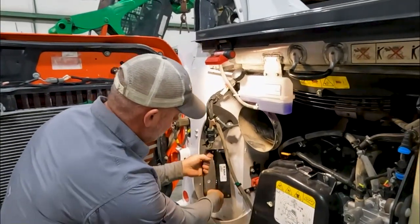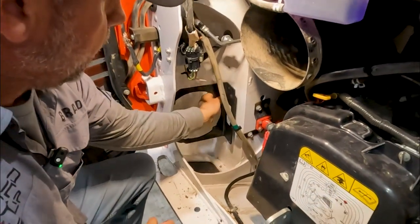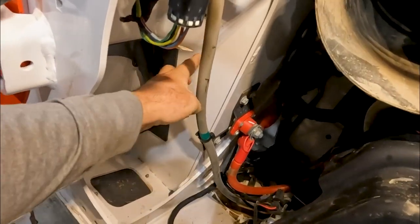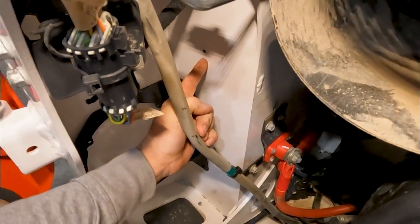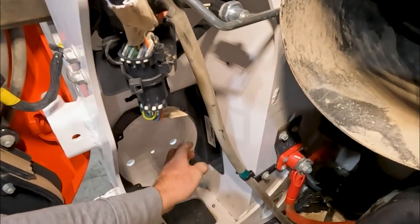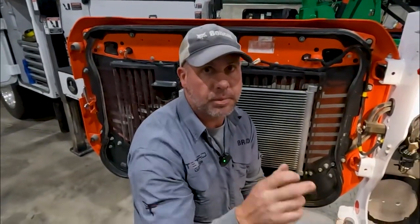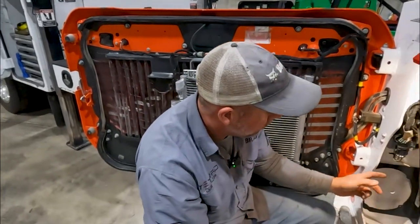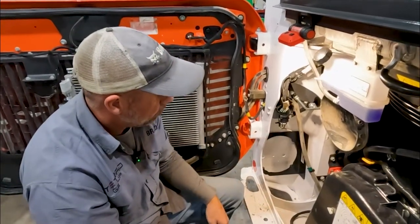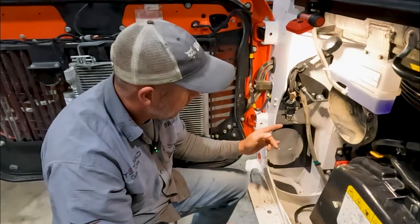The bracket is going to come back down in this part of the frame, and it gives measurements to drill holes in here. I've already started this project and got one down here. The instructions say to use a 10 millimeter drill bit, which is actually a big drill bit - that's almost half inch. But the bolts they send are really small, like a 5/16. A 5/16 hole would be just fine to drill. I think the newer serial numbers already have these holes drilled, but I had to drill these in.